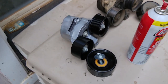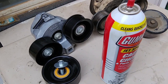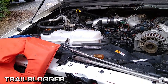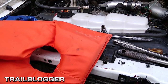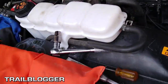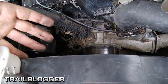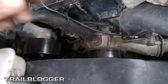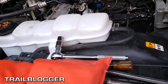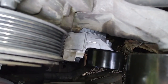I'm going to go ahead and toss these on there. I don't really have the tripod out today, so I'll just toss it all on and show you guys when I'm done. Maybe just show you a little tip about how I rerouted the new belt once it's on there. First I'm going to install the tensioner and then the idler pulley, since the tensioner is below that and it makes it easier to get to. I got the new belt tensioner in there. This old life preserver actually worked pretty well — I lay it on my stomach and just kind of reached over with my left hand.